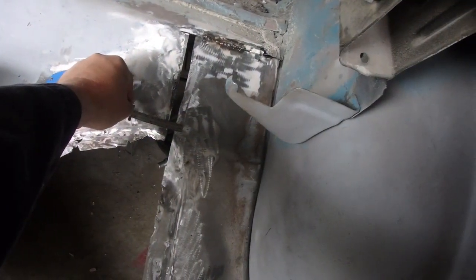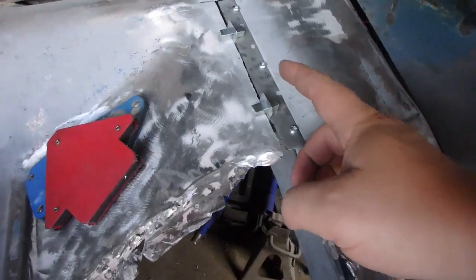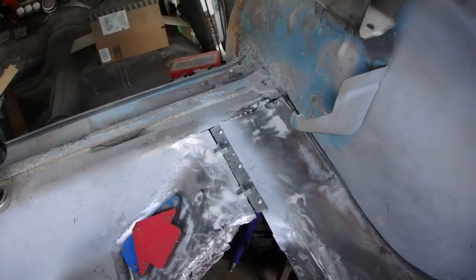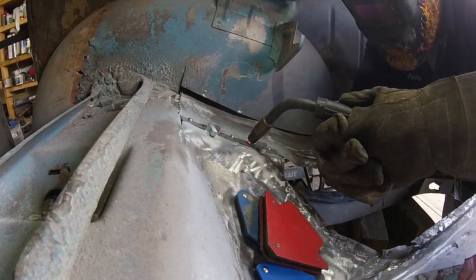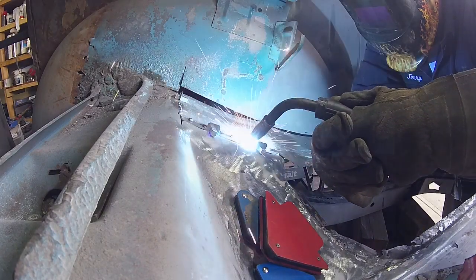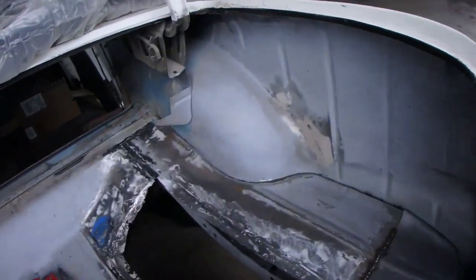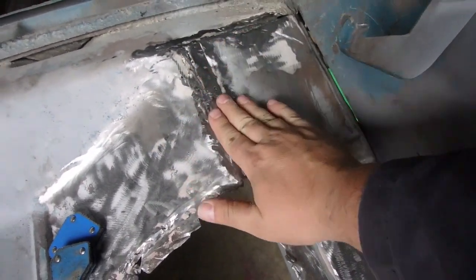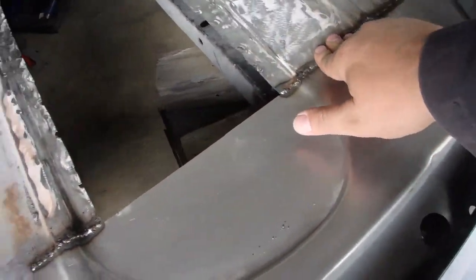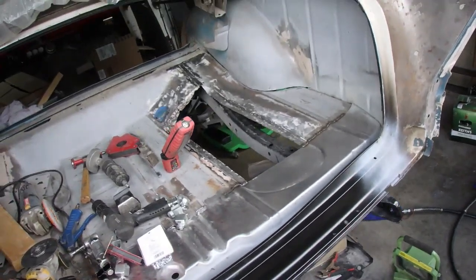Doesn't seem to be too much happening outside today. It's time to quit screwing around. I got that piece put in, held in with some sheet metal screws, so I'm going to weld it down. These little clamp things come in handy for making a perfect line. Hopefully it doesn't rain before I can get this finished up. Put that top piece welded in — once I'm ready to start doing some bondo work I'll do a little bit more finishing on that to smooth it off. Let's start grinding this off. I've got to do a little bit more welding — weld in those grooves I cut with the grinder.